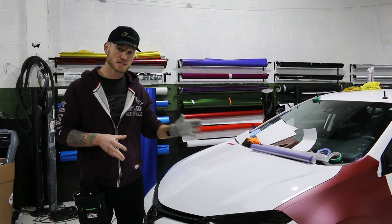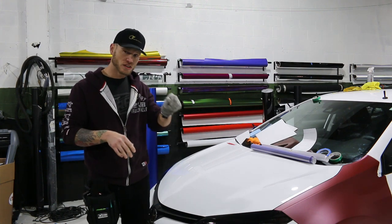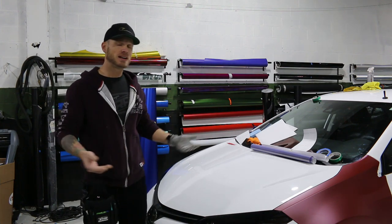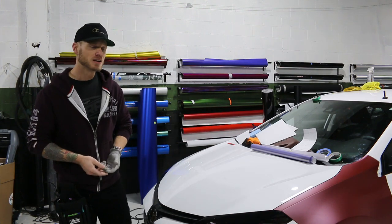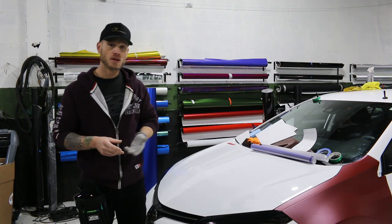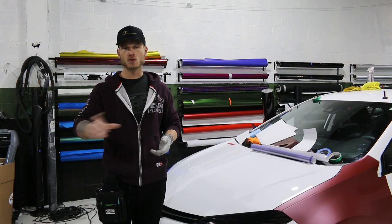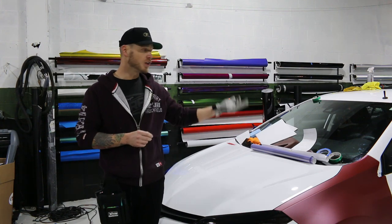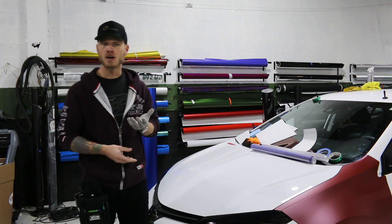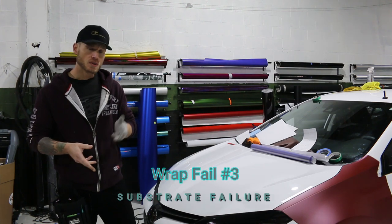Reason number two: you can check how the film is sticking into the recessed area. If the film is still sticking and you can push it down and it doesn't want to snap out right away, most likely you just didn't post-heat that area properly. In any other case, slap some Primer 94 or adhesive promoter into that area — adhesive promoter would have held the wrap down and prevented it from lifting. The less lazy way would have just been to post-heat the area. We have to heat it to a particular temperature to make sure it's settled — not just heat it to 100 and call it a day. That will reset the memory in the film.